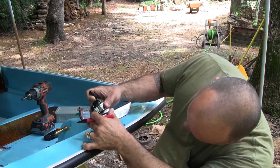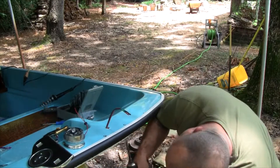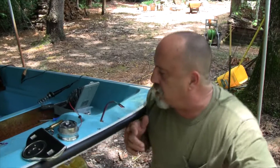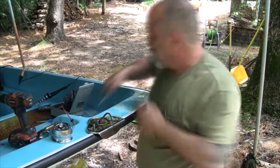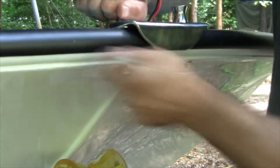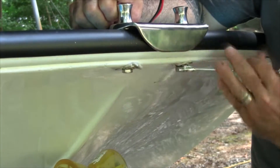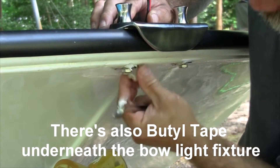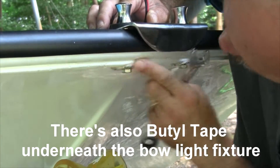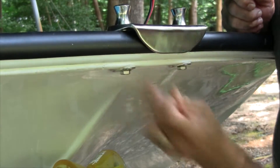I centered it so that it's centered. For the bottom of the mounting screws and washers, I put butyl tape in there. This area is bound to get a lot of water splashed up on it, and when I was rebuilding this area there was a lot of foam washed out and delamination. The better we protect it from water intrusion, the better off it'll be.